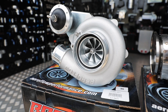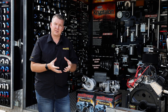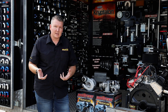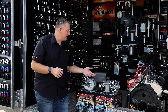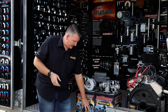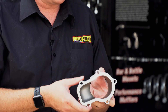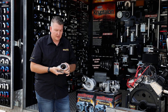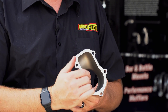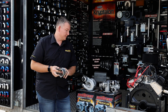On the rear of the turbo we've adopted the Ford-style flange bolt pattern — a five-bolt Ford bolt pattern common to the Barra bolt-on turbos. We did this because we know the internal gate design works, and there are plenty of flange options out there for the XR6 turbo bolt pattern. We've also got this adapter that we've used on this Skyline for the dummy fit and testing — it takes the five-bolt Ford outlet and converts it to a three-inch V-band, making exhaust fabrication really easy.